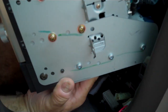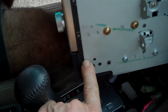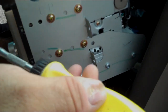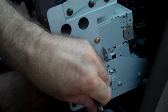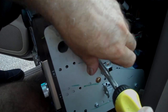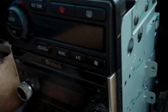Now we have many mounting screws on the side of this car stereo. You can see the mounting bolts go across to hold the OnStar module, hold the AC controls, and four here that hold the stereo in place. We remove the four screws for the stereo — this will free up the right side — and we repeat this for the left side as well. Hopefully we can push this stereo right out the front of the brackets, as long as it's not attached at the top or bottom of the face.